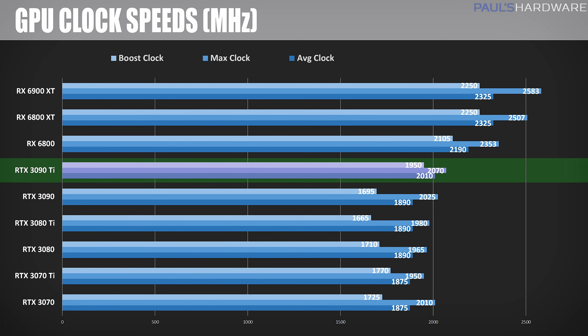Let's look at the actual clock speeds I was seeing out of the cards while in use. Note that listed base and boost clocks for modern GPUs can often be ignored, as real-world measurements almost always show them running at higher frequencies. The 3090 Ti peaked at 2070 MHz and averaged about 2010 MHz after a long test run. It ran at about 2040 to 2055 MHz when below 70°C, and about 2025 MHz when between 70 and 74°C. Frequencies may go up if ambient temperatures drop, or go down in an enclosed chassis with limited airflow.